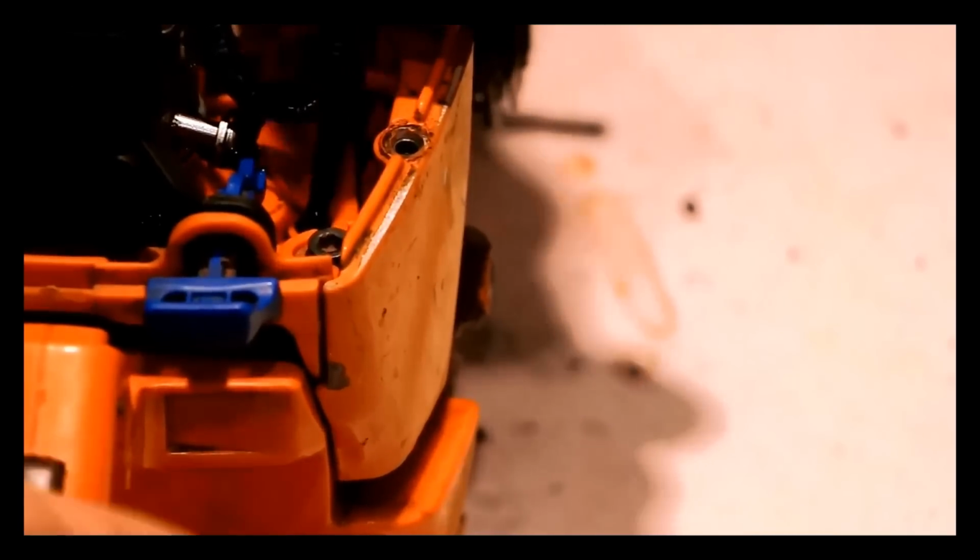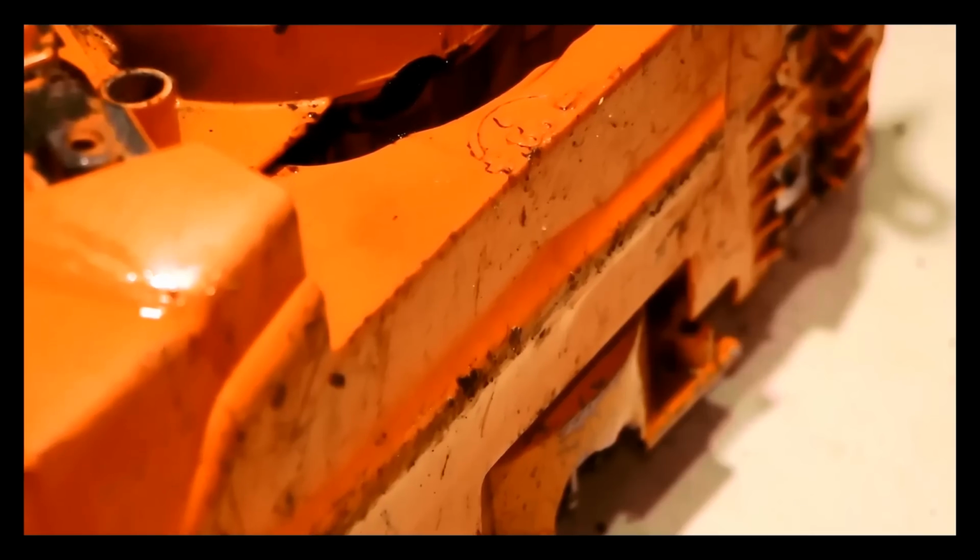We got some fuel lines to contend with. So this is the impulse line. We're going to pull that off. Fuel line, which apparently is still under pressure. Well, we know that we can pressurize the fuel tank. Now this other line here, which just literally fell off, looks like it's going to need to be replaced. Pull that down and through. We'll investigate that later.